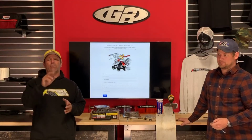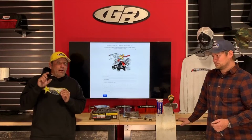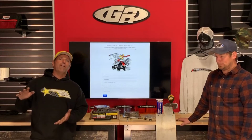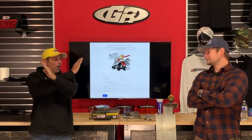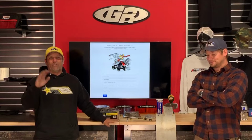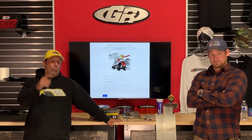And laying that shock down, I'll give you an example. When they lay that down like they do in the back, they have to go to 400-pound springs, where we're running a 150 and a 200. That shows you that they don't have it right. It's over-leveraging, and it's working so hard to try to keep the Jeep stable. Think about this: the shock's already laid back like this, and now you go up a hill. Now where's the shock? It's laying down in the dirt, man. That's not right. You don't want that stuff. So, guys, just stop looking at that junk and steer your buddies away from it. And if you're watching this program, you're on the right track. All right, what else you got?